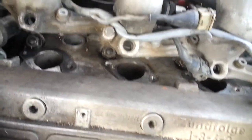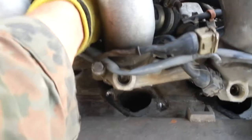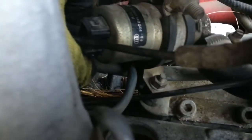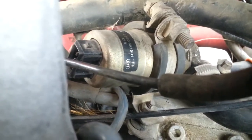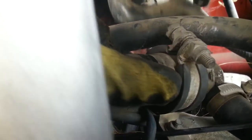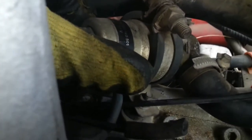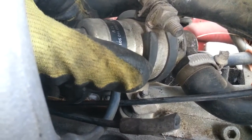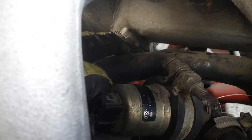Anyway, I think I'm going to fight with it a bit more. I'm just going to have to guess, because you can see where this used to be mounted. Apparently this is an air bypass valve, and what it does is it allows air — after the filter but before it gets to the throttle body — to bypass the throttle body and come in the back of the intake manifold.